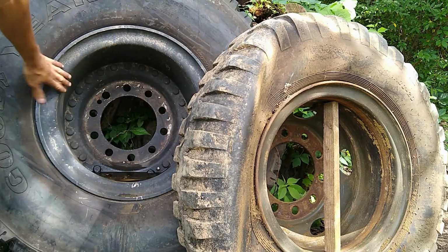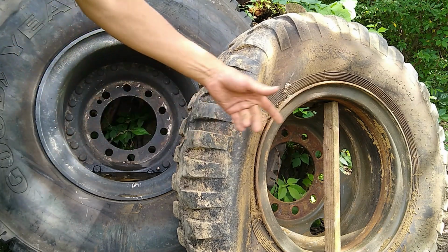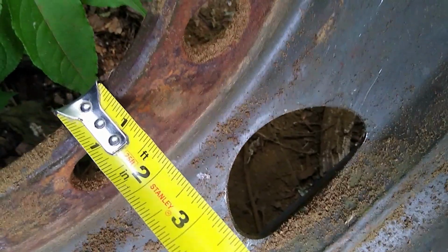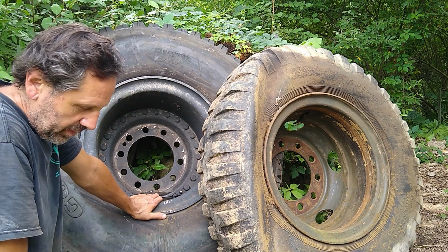So obviously the aluminum wheels are just smaller diameter inside here enough, thicker, that I can't get it on my truck. The thickness of these wheels, at least at this point, is about 1 1/8 inches thick. And that's why I needed longer studs. Steel wheels, here we've only really got about less than 1/2 inch, probably about 3/8 of an inch. So I talked to the guy who sold them to me, asking him questions, and he didn't remember that problem existing.